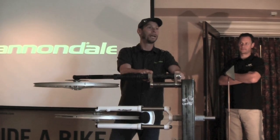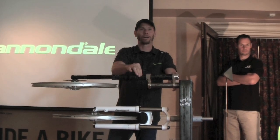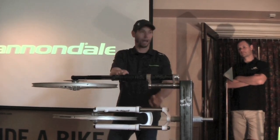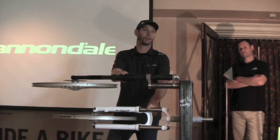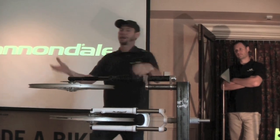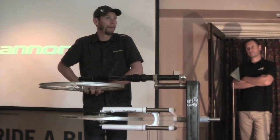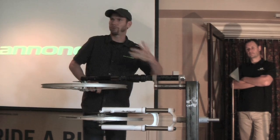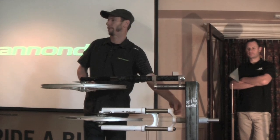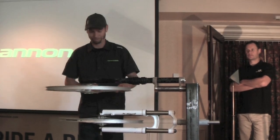This is typically an application for downhill. Downhill we would do that, but we're talking here, and I forgot to mention that, this fork is more than 300 grams lighter than this fork. Okay, so if we beef up this fork by 300 grams, this would not move at all. But it doesn't make sense to make it much stronger because you have a limitation, that's the wheel. And just for the guys who have not seen that, they both are without dampers. There's no damper inside, that's why I can move them.